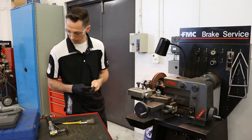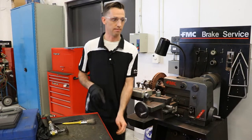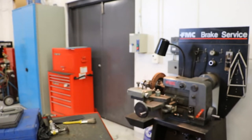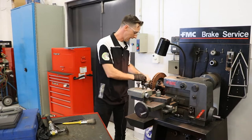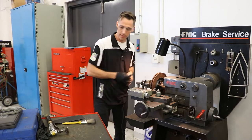So there's a tool for the job and it's over here at this other lathe — I'm just going to step aside and grab that. Here it is — a very special wrench. Remember again, this is a left-hand thread, so counterclockwise to tighten it and that's all we need.